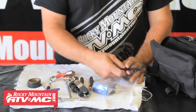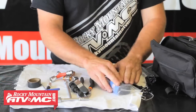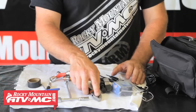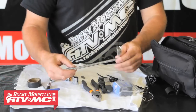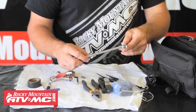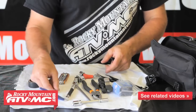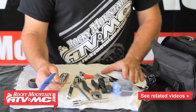In our next compartment we have zip ties — a good amount of them. We have this incredible Motion Pro tape that works for a lot of things: going around a radiator hose, all kinds of things — it's self-stick and you could use it in a bind for whatever you need. Chain breaker, custom bits for our screwdrivers, and good pliers can be very helpful for wiring, cutting wire, and grabbing onto a nut securely. Tusk T-handle set — we have 8, 10, 12, and also bring a 13 for any KTM buddies we have out with us. Tusk also has a nice multi-tool with lots of little Allen bits and a small screwdriver. We have a spoke wrench for our common sizes and a pipe spring puller to help get into tough spots.